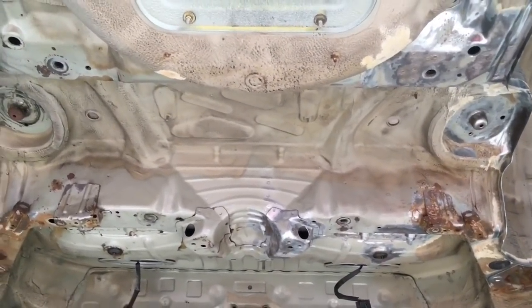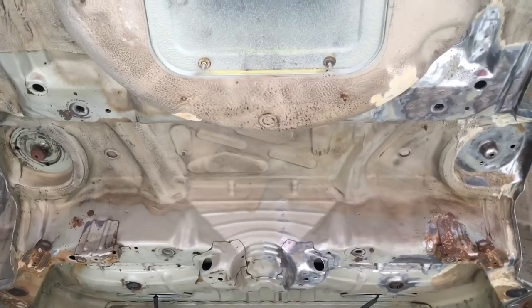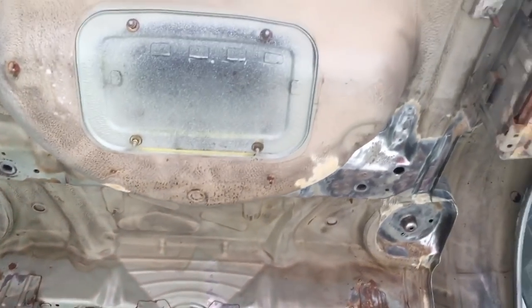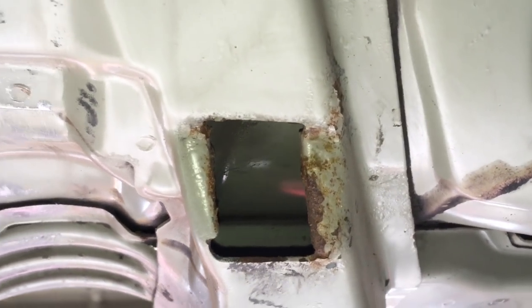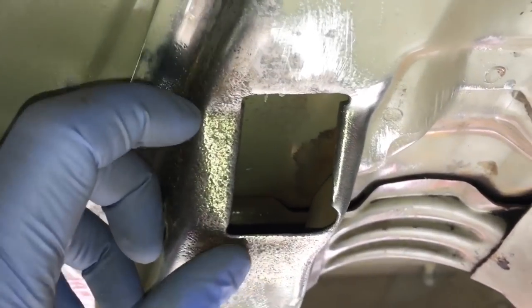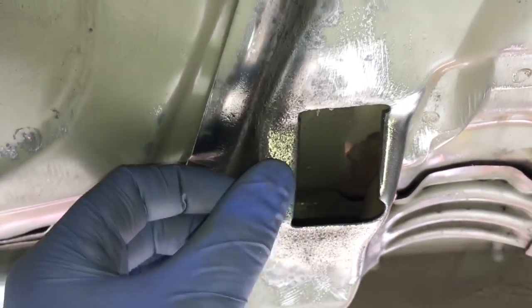Now that it's degreased underneath, I thought I'd start on the corrosion first. This customer has specified some extra labour to tackle the corrosion areas to make sure those are neutralized, treated, and held at bay for as long as possible while we've got great access to the underside of the car. I've started on the right hand side, just taking out the corrosion around that handbrake console carrier. It doesn't look much from far away but get close and you can see the corrosion is fairly deep around the edges of these pieces. It's still present because it's in the pits and peaks and troughs of the metal grain — you can't actually get that out unless you thin the metal down, but on a 1.2mm panel that would be pointless.